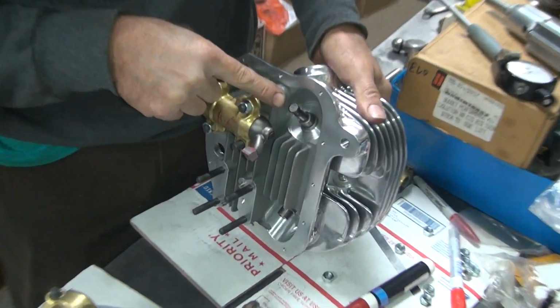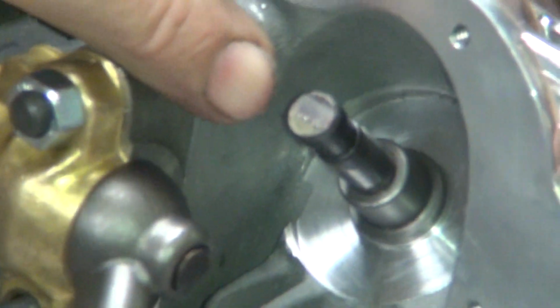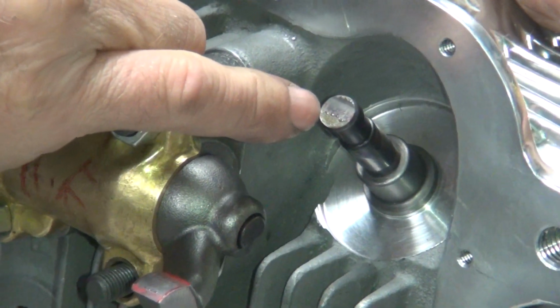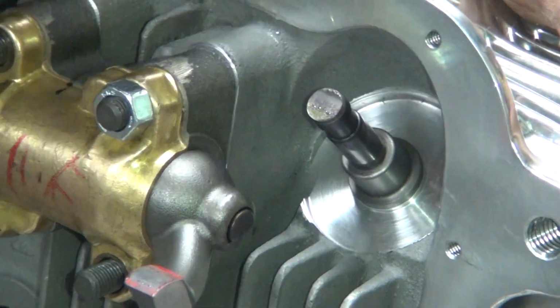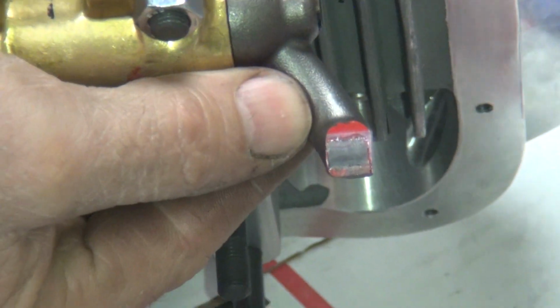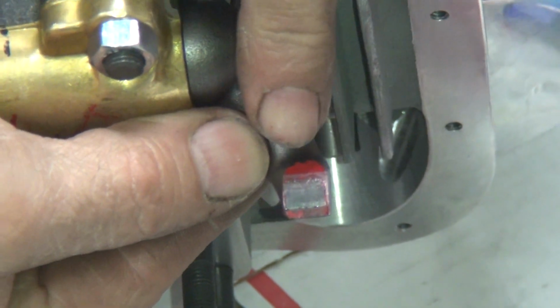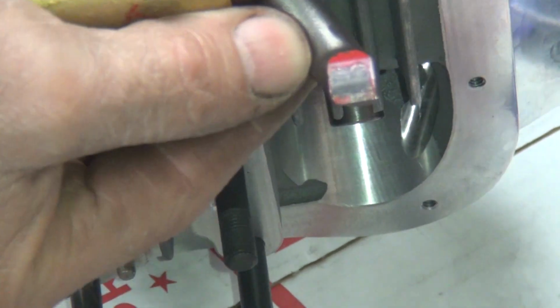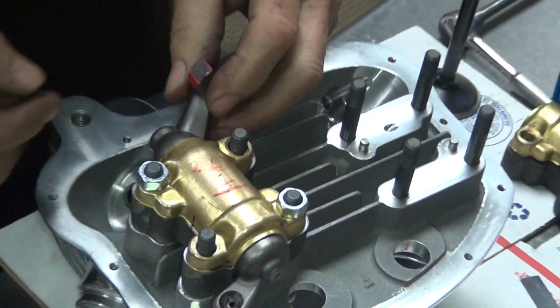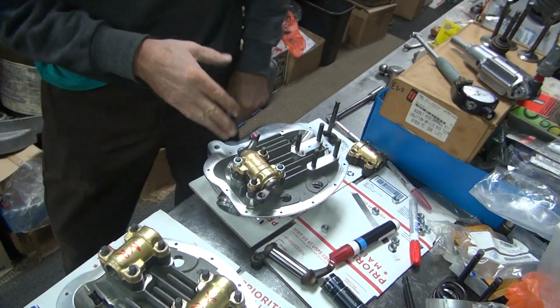Valve. Yeah, it looks like it's going straight across. It's not going off the edge. It's starting in the middle. It's only going out. It's not sweeping across the whole face. We are lapping across the whole valve face there, which is good. So we're just not picking it up soon enough.